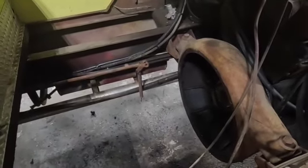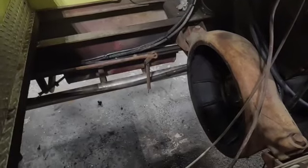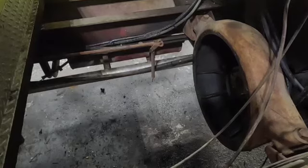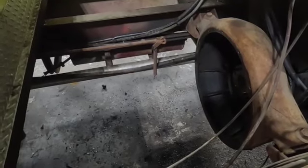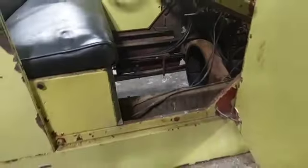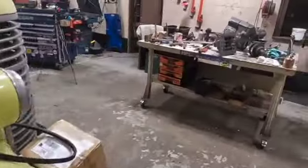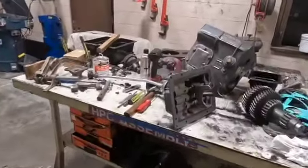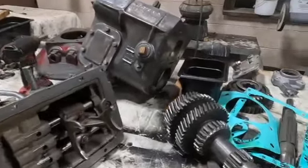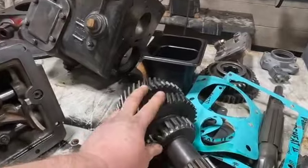There's the giant hole here. Transmission used to be there. Now it's not. The clutch was no good, and we took the transmission out, and in order to do that, we took the top off to make it easier to remove underneath the truck. And we looked inside the tranny, and it was all rust and nasty stuff. So here's the tranny over here, and I'm rebuilding this right now. Got gaskets made. We tumbled all the gears.